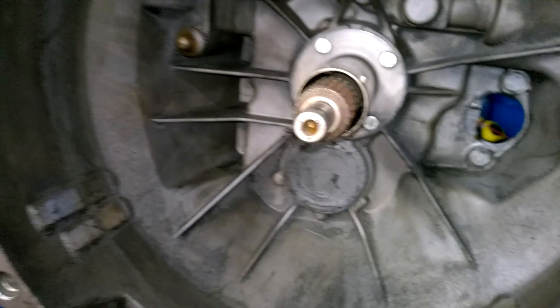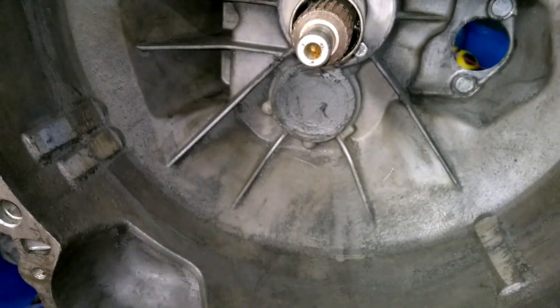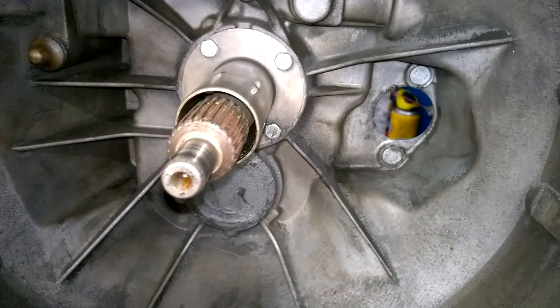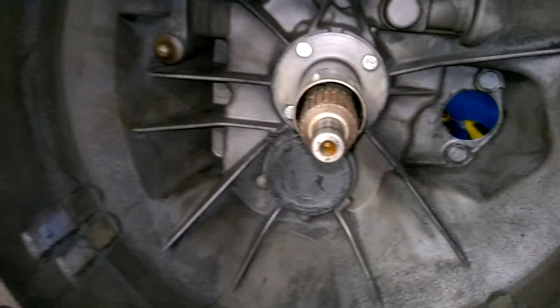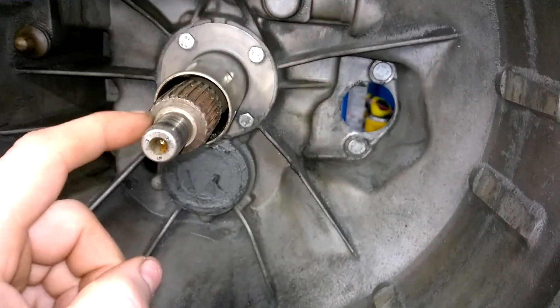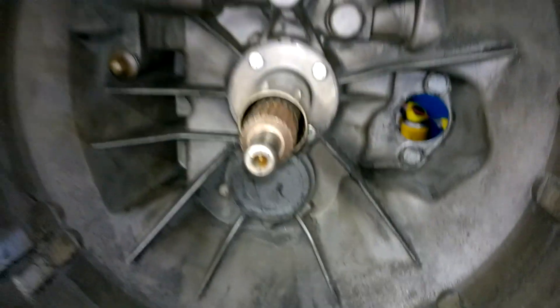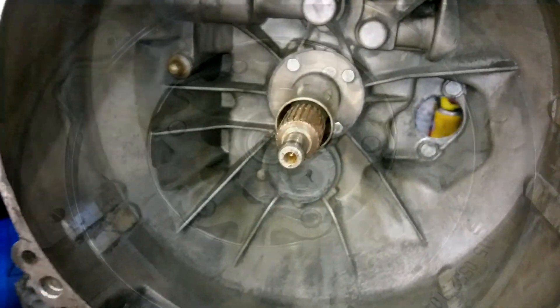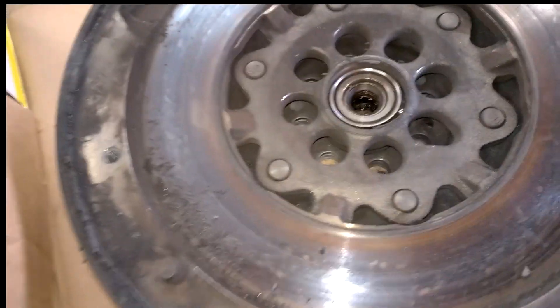I just want to show you this area as well — I've got this all cleaned up, vacuumed out all the dust, cleaned off the shaft on both sides, and I'm getting ready to fit the new release bearing onto it. I'll also be greasing this area and this area, making sure that everything is nice and smooth and free when it goes back in for install.